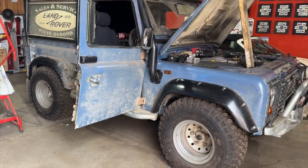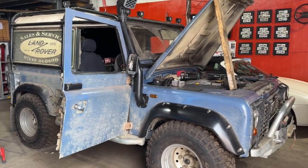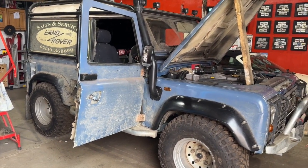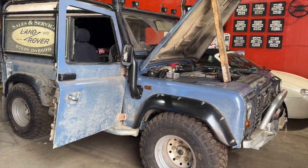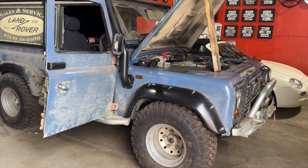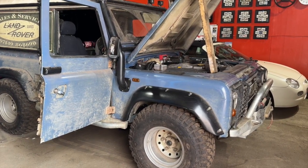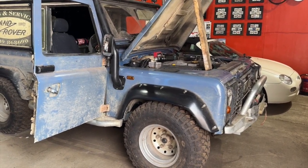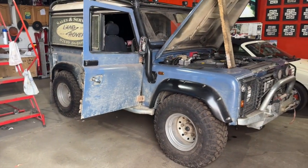Very nervous. Well, it was running for 40 minutes and no issues to speak of. The only thing I did find is when I tried to put the suspension up, the front near side corner wouldn't go up. I loosened the dashboard and it started moving — one of the pipes was slightly kinked. So I've just rerouted them so they're not such a sharp turn. I might have to redo all that because now there's a lot more behind the dash and it is getting a little bit tight. But at the minute it works, so we'll leave it for the time being.